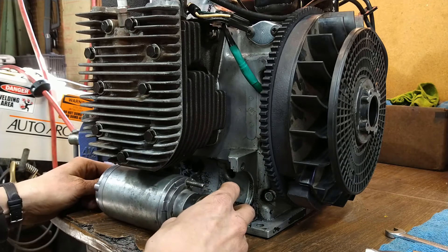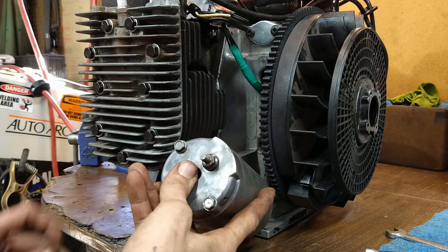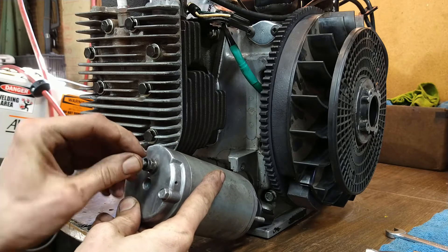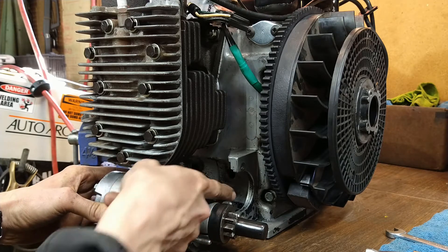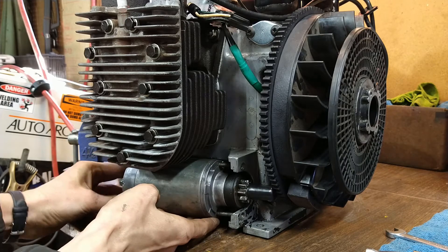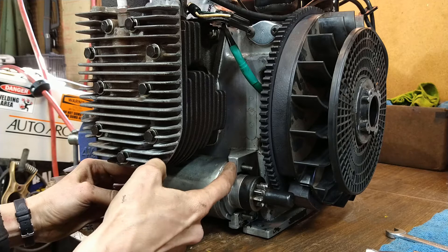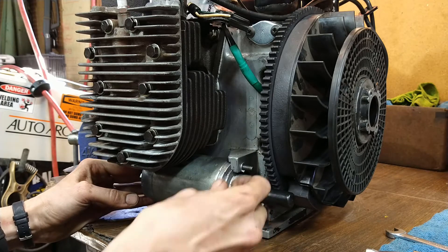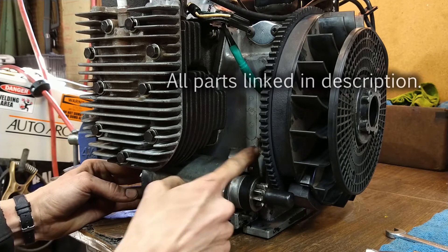Once the shrouding is over here you just can't get to it. Be careful with the rear stud — make sure it isn't going to spin and snap inside when you go to tighten your positive lug on this one side. There's a register here where this will pilot into the case, and you've got two holes down here. Slides in like that, and make sure that the register is correctly seated right there. I'm going to put a lock washer on this.